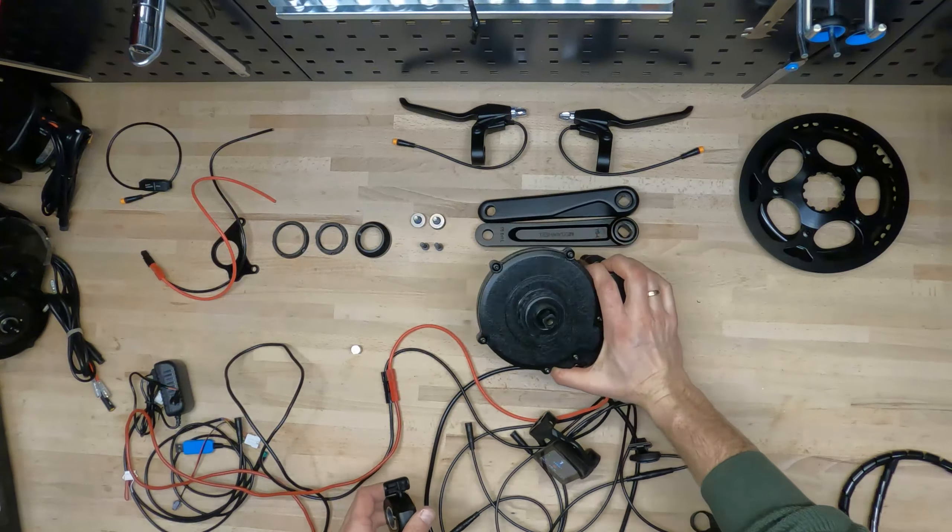Let's take a look at the controller. I need to count the MOSFETs because they are rated for more than 750W. On the TOS7 motor — 12 MOSFETs. On the Bafang BBS02 — 9 MOSFETs. So the TOS7 has more. Maybe better to compare with the BBS HD controller, but we don't have an open BBS HD controller right now. What I can say is that here there is actually less waterproofing than on the usual Bafang BBS motor. I don't like this connector — like middle quality.